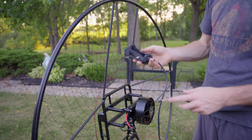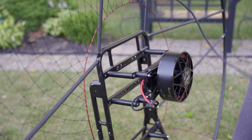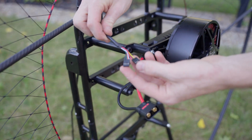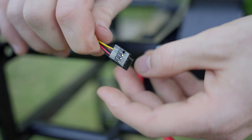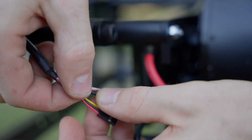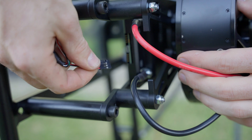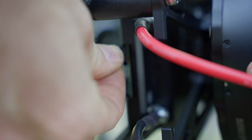Next we're going to grab our throttle hand controller and go ahead and plug it in and zip tie it going up through our frame. We just want to make sure the zip ties are nice and tight so that if we fall or something like that, we're not going to yank the wires out. I slide it through this hole right here in the back. This is for a left-hand controller, which is the normal setup. There are two sets of wires with an orientation to them — this side has four pins, and this side has three pins. When facing the back of the motor, we want the pins facing us. Take the connector with the red, black, and yellow and plug it in the bottom. Make sure you don't flip it around — we want to see the pins when looking at the back. Slide that in nice and tight, then do the same to the top one.